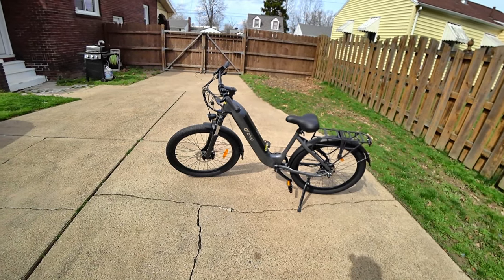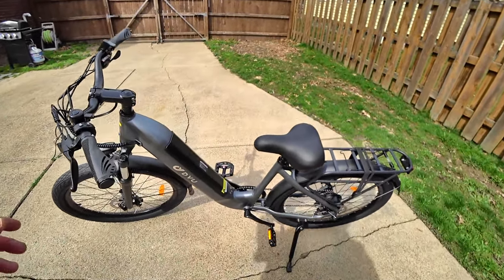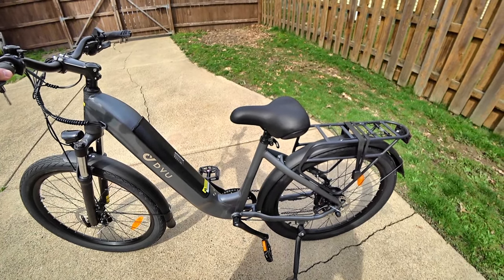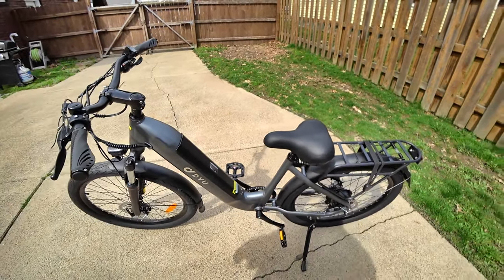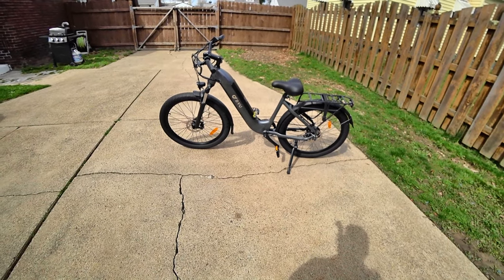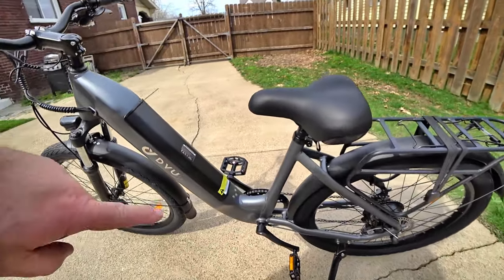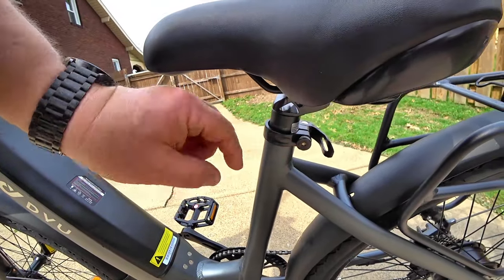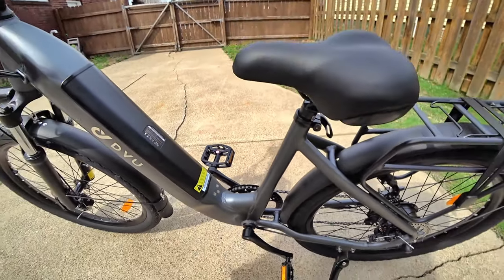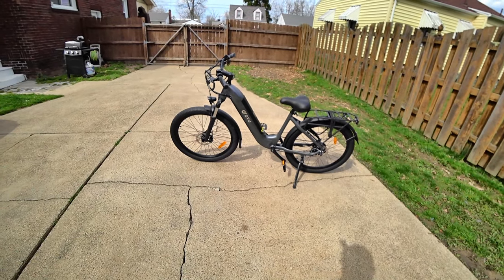Check the specs. As far as the height, I think that they say a rider of as short as 5'2". Yeah, I think the seat goes down just a little bit more there, but I know Heidi could ride it at 5'4". She wouldn't have a problem with it. It's a little tall for her, but there's ways around that if you want to. You can cut down this tube right here and slide this collar down and make it clamp there. There's a little bit of modification that needs to be done, but that can be done, just to let you know. It's a good bike.